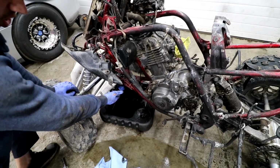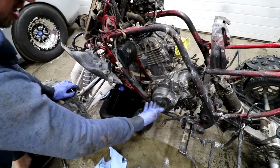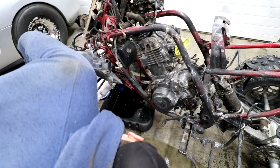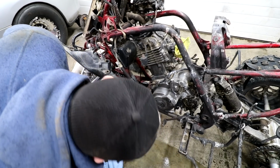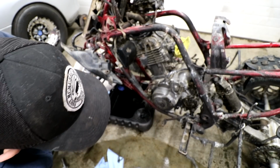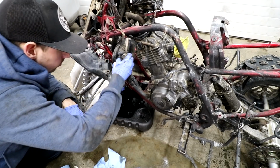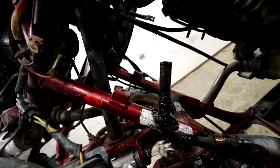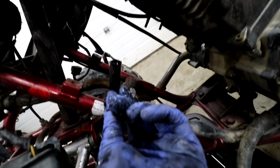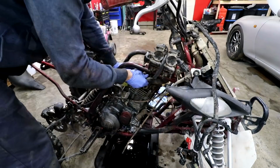That's different, having the engine oil external to the engine. Usually it's like down in the crankcase, but this probably has a pump in it that runs off a chain somewhere that pushes it elsewhere, which is pretty cool actually. If that's any indication of anything, a bunch of metal on the screen it looks like. Who knows, maybe we got a junked motor.